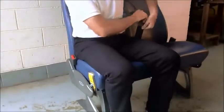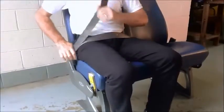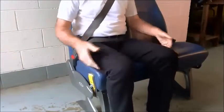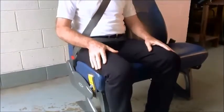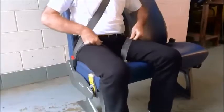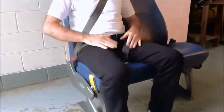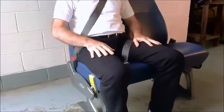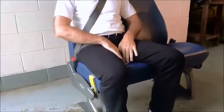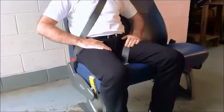I'll demonstrate SOS as part of the new features for Lifebelt. You put the seatbelt in the normal way, and at this point you have the standard Lifebelt situation with the belt running underneath. But with SOS additionally in the seat, you have the option to engage the lap section of the belt with the Lifebelt in the seat, and this creates a crotch-strap type situation, which is very common in child restraint situations. This is specifically suitable for smaller occupants and provides guaranteed anti-submarining protection.